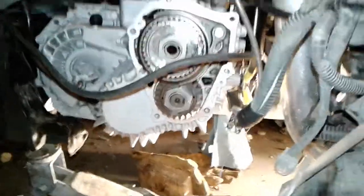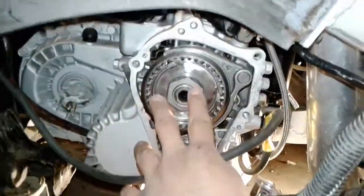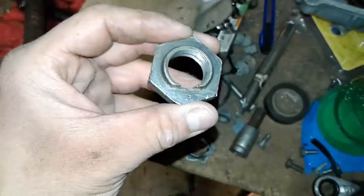I'm doing the transmission stake nuts. I redid my transmission a while back, and on the turbocharged 4G63 F5M3 transmissions — front wheel drive and all-wheel drive — you have two stake nuts that are torqued down and then air hammered or chiseled at the ends so they don't back out. Most of the time you have to cut them off.